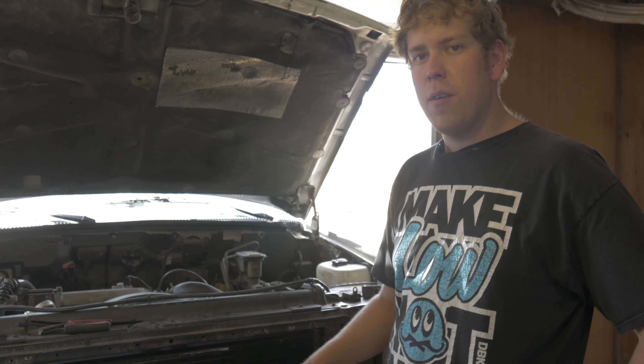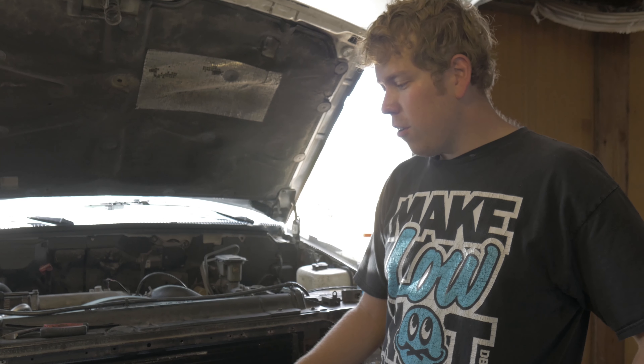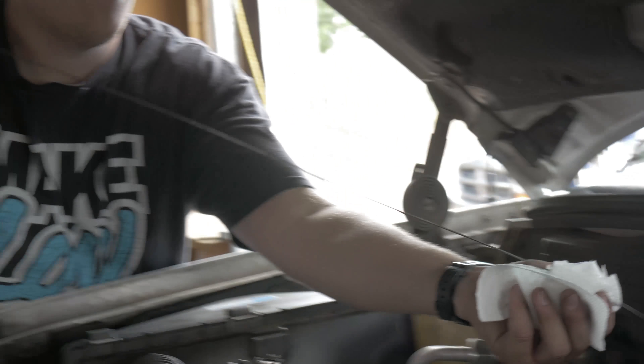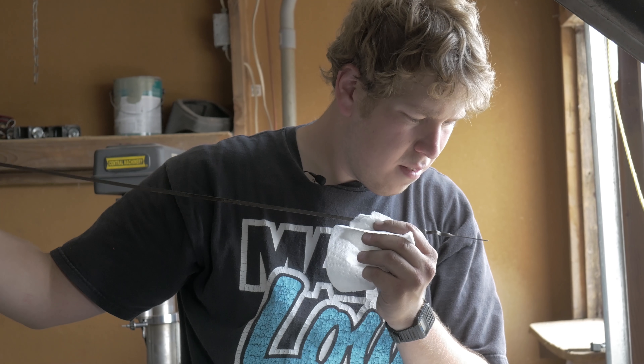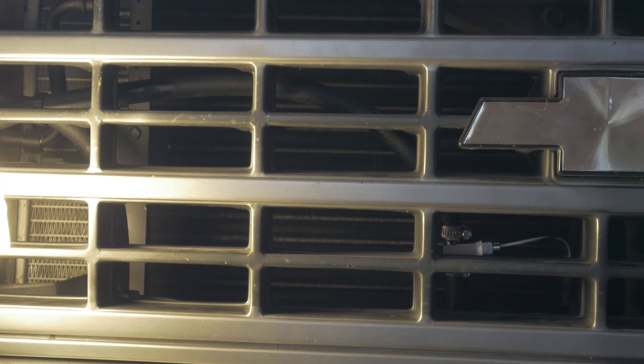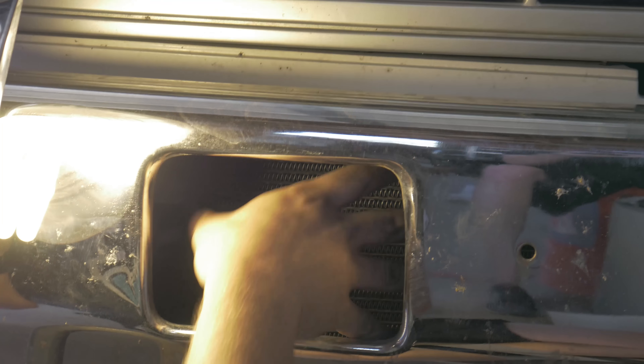Now all that's left is to button everything up, start the truck, and check the transmission fluid. The cooler does make a huge difference, and having it in a spot that's out of the condenser really makes a huge difference with the engine temps. As you can see, you don't see anything except the hoses up here at the grille, but you're still getting the airflow straight out to the transmission cooler. So you're not impeding any flow to the cooling stack, but you are getting complete, direct airflow to the transmission cooler.